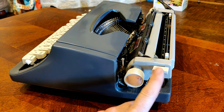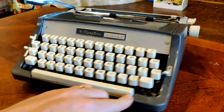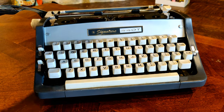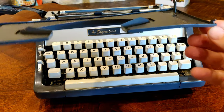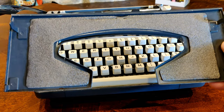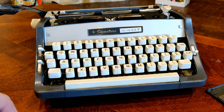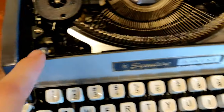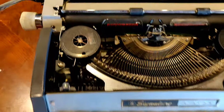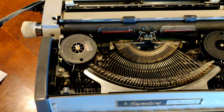On this model we have just a single carriage release lever — push that and the carriage will move so you can adjust its position. The ribbon cover is a little different: it has hooks on the ends and a much larger hook on the front. The other flat-top models had four rubber bumpers, but they've repositioned them to the front here. I've already replaced these — they're now clear, soft, and springy, whereas they were crumbly before. You can see it's the same JP-1 guts and internals that have worked so well across all these models.